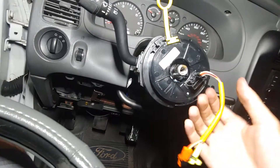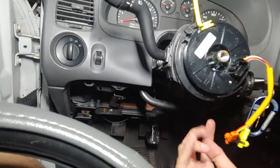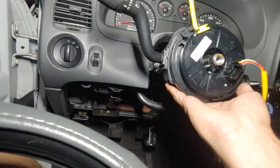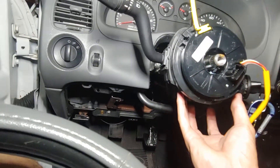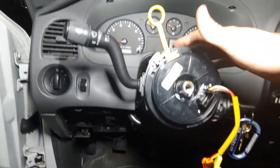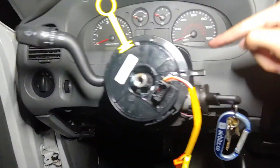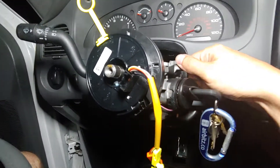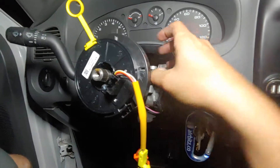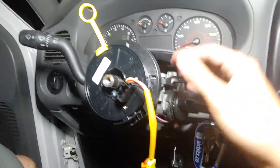The connectors will route through the steering wheel. For the column covers, there are two or three Phillips screws on the bottom plastic cover — take those out and pull the bottom cover off. The top cover hangs on the turn signal lever, so I had to force it off, bending it just enough to clear the lever, and after that it came off easily.